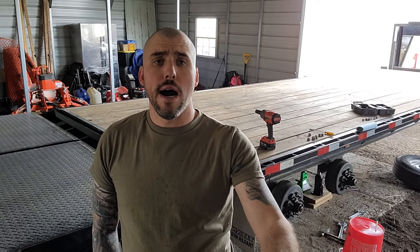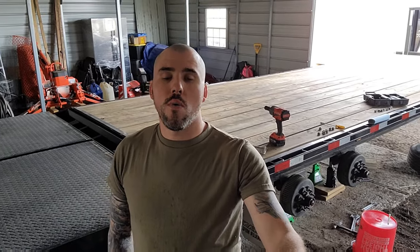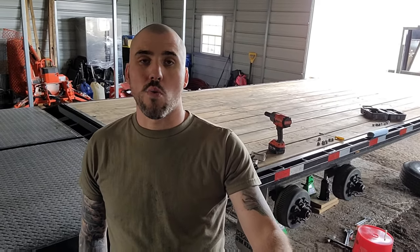Alright guys, that's going to sum it up — I've got the other three hubs to do. Hope you enjoyed this video. If you enjoyed it, please shoot me a like and a subscribe. If you have any comments or questions, please don't hesitate to ask. A big important thing: make sure you have your seals ready for your inner bearing, and make sure you use the proper grease — not all grease is rated for wheel bearings, so make sure you get wheel bearing rated grease. A bearing packer gives you a much better pack for your bearings. Thanks for watching and stay tuned for more Hotshot content.